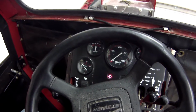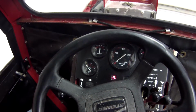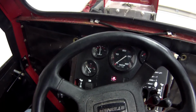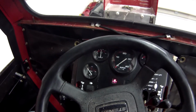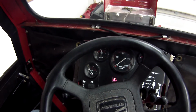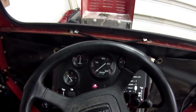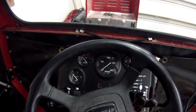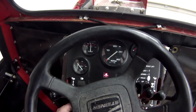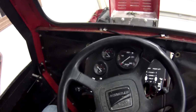All right, just as soon as I shut the camera off, my idiot light came back on. So I don't know if it's the fact of maybe because it's in there sideways, for the pressure switch, maybe it's supposed to be vertical, but I don't see how it would matter, because with a system with oil pressure, I mean, pressure's pressure. I don't see what anything different would be. But for what it is, as you can see, this thing's been off for probably 45 seconds to a minute before the low oil pressure indicator light even came back on. So having the gauge is definitely worth it to me.